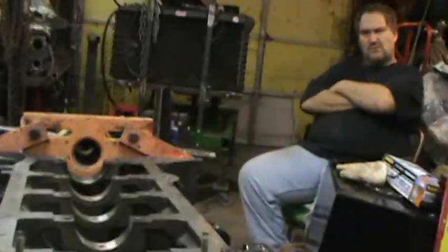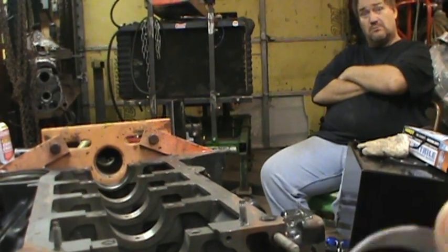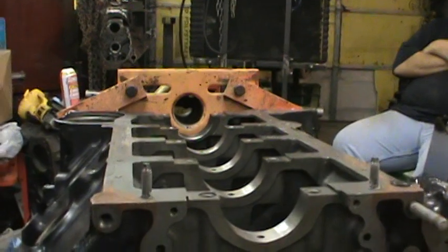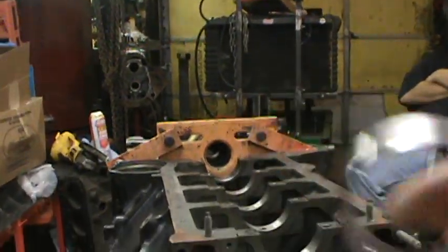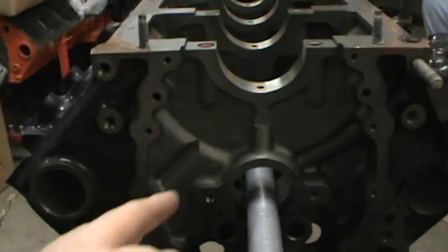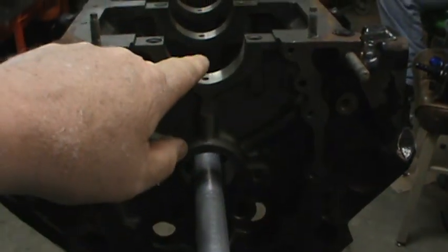The rear cam bearing — number five — goes at four to five o'clock as well. The front bearing has two holes; I've looked at how the factory did it and they just picked one hole. Since the front main and front rod are basically the last to get oil, I put the bearing in with the two holes up so oil floods that front bearing. The other three in the middle I put at the seven o'clock position, because that's the direction of cam rotation — oil comes in, gets pulled down, and works around.